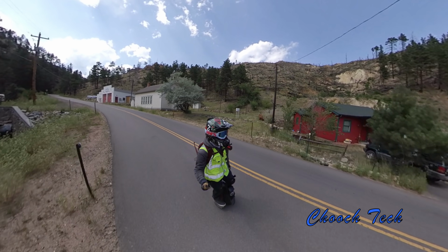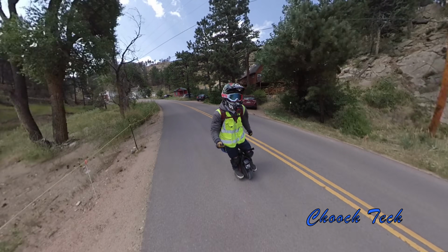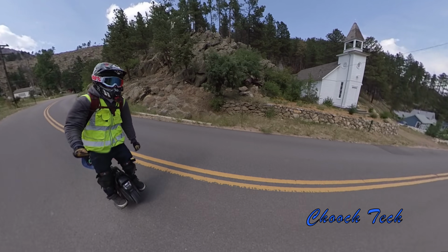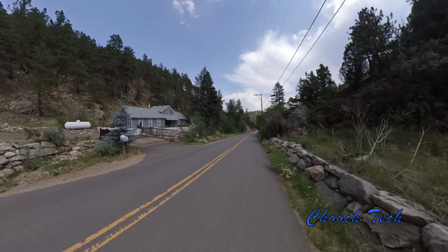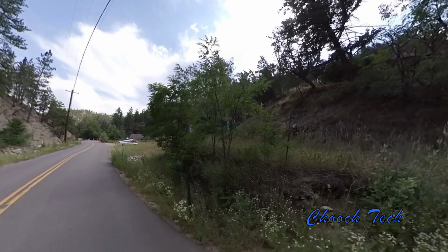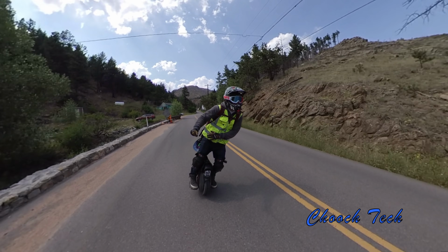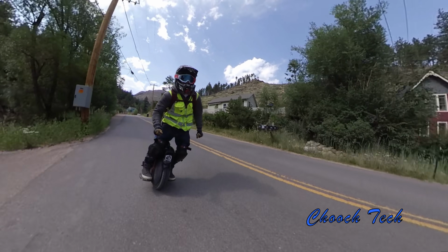When you get on the wheel and stand on it flat, propped against a wall or something like that, you should have at least half an inch to an inch of drop. About a half inch of your pedals dropping will give you so much more control and flow and just use of your suspension. I'm seeing people fighting the suspension in the V11 videos, and with me, I've got it dialed in, and I'm grooving with it and loving it.